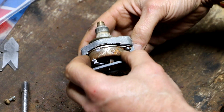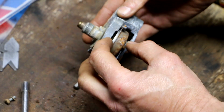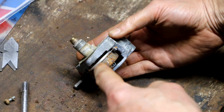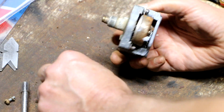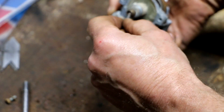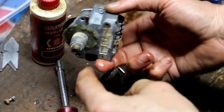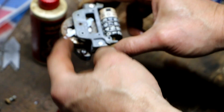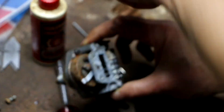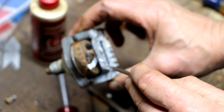Although, I guess there's nothing that would stop us from just spraying a bunch of lube in there and seeing what frees up. So I loosened these two screws just so I can move this cover forward, knock out some more chunks of rust, and expose this a little more so I can spray some penetrant in there. And then I've got a square drive bit that actually engages the back nicely, so I'll be able to try and work that free. I was able to get this freed up so it rotates freely now. But it's completely trashed because what I realize under magnification is that right down inside here there is a clock spring.